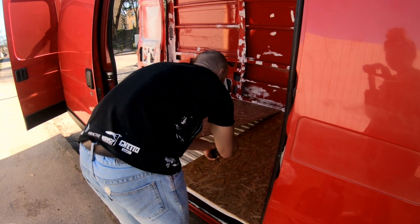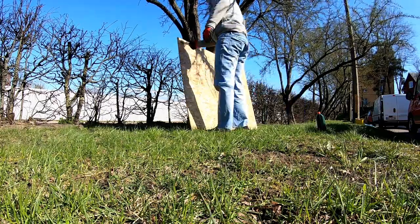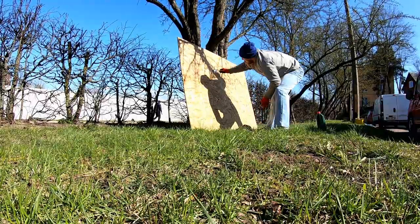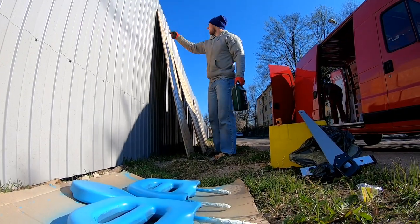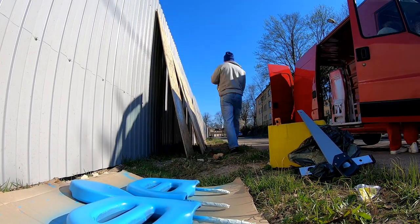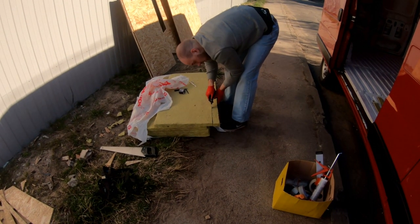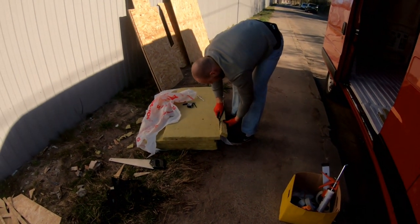After cutting the plywood, we made sure that it would fit the van perfectly and adjusted the pieces a little bit. Here you can see Ritvars was spreading some linseed oil over the plywood, which protects the plywood from mold. So now we have all the XPS foam boards and plywood pieces cut into their correct sizes, and we're ready to start the van insulation.